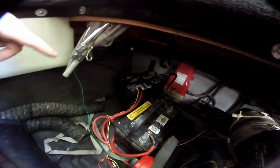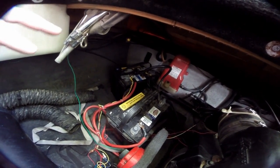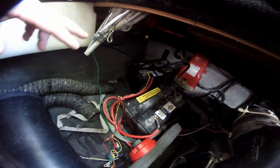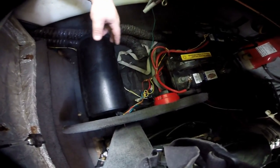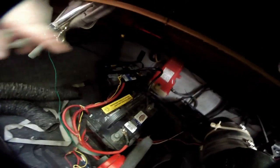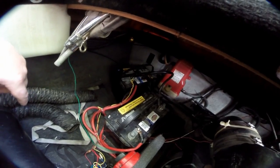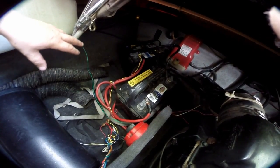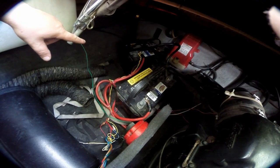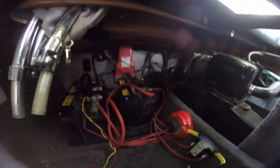Here's the mess we're looking at. You can see there are our two batteries — that one's the house battery, this one's the starter battery. They have some power cables but we need more. We also need to secure this subwoofer and fix some of the wiring. There's a bunch of stuff running to that battery over there which I don't like, and I don't like that the contacts aren't insulated. So the first thing we're going to do is pull all of this out so we can install our battery trays in the far back, so all the battery weight is in the back.